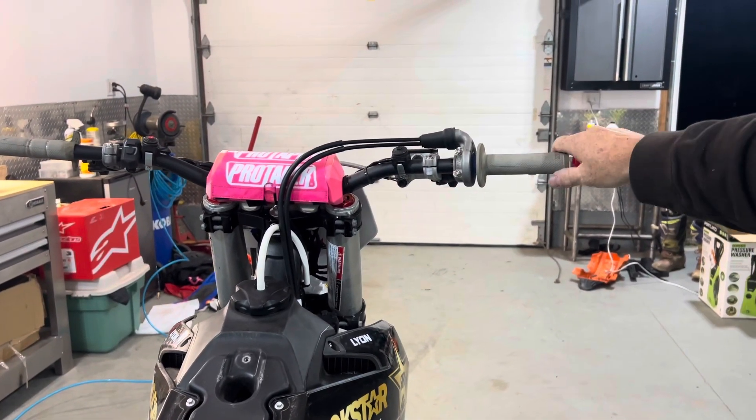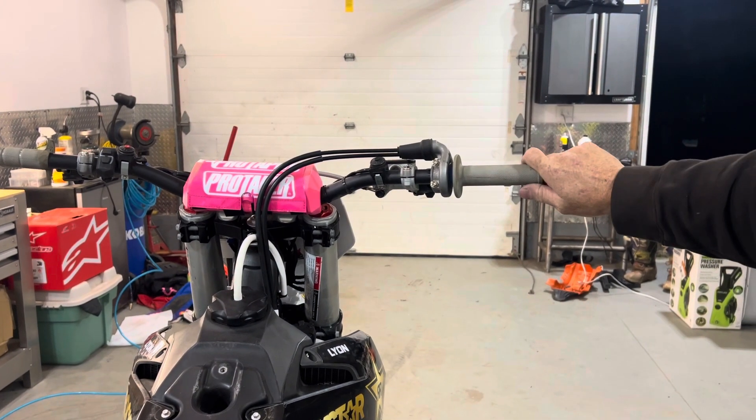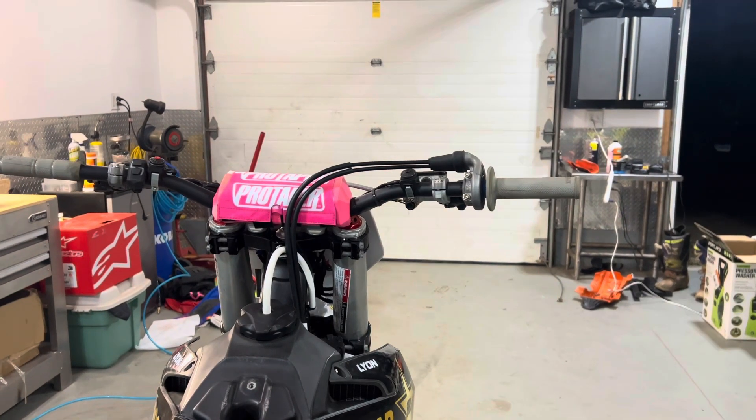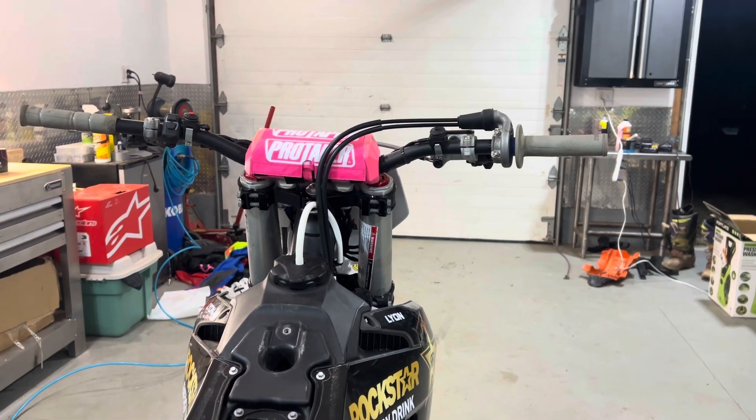That covers the basic powering up of the system with the wake-up connector through the access port. Remember, it's not a half throttle for the GET — it's a full grab of the throttle. Start the bike in between resets and make sure it switches between maps.